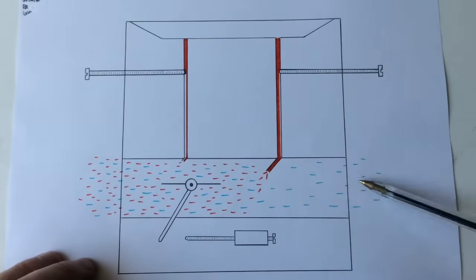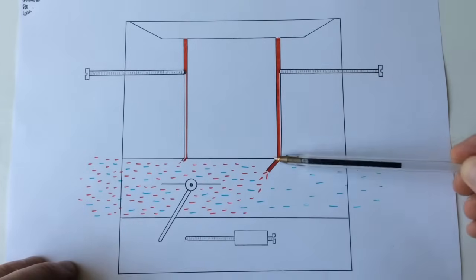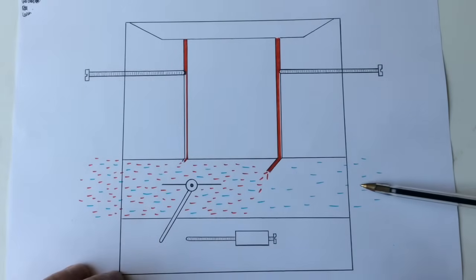Absolutely more. So what I'm tending to get now is more fuel going in than air - quite a lot more fuel. And if I carry on like this it'll affect the engine - it will be too strong a mix of fuel to air for the engine and the engine will start to lag a little.